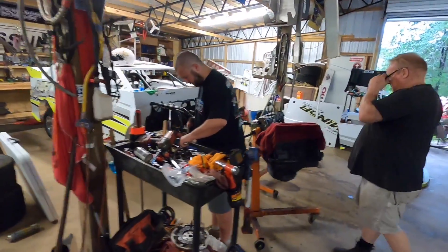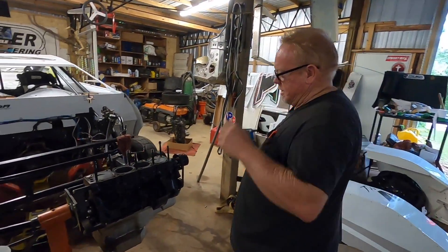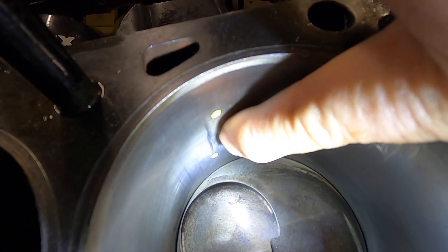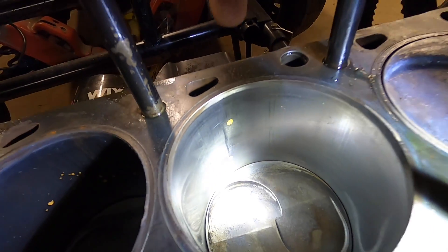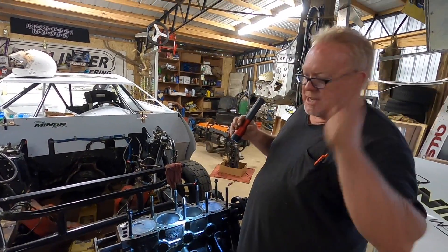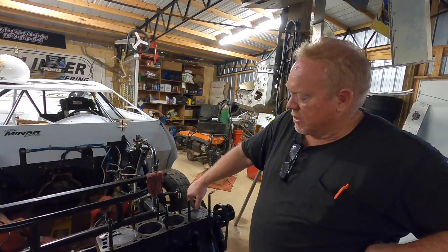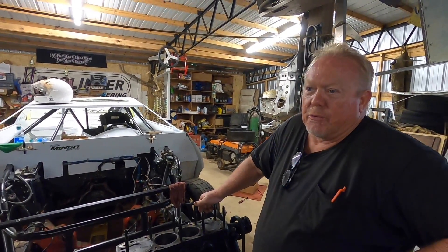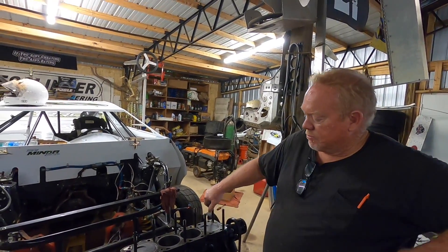And there's Deuce — got the motor out of it. Dad's been down here working on it. The issue was we had a split cylinder — number two. If you shine a light you can see it right there between those two dots — a little split in the cylinder wall. What it does is it puts water inside the compression chamber, gives you the antifreeze smell out of the exhaust, steam out of the exhaust. We pretty much knew the other Saturday night when we smelled it. These motors never really blow a head gasket — we've never blown a head gasket on a 2.3 motor — but most any time you get something like that in our experience, we'll have a split zone.